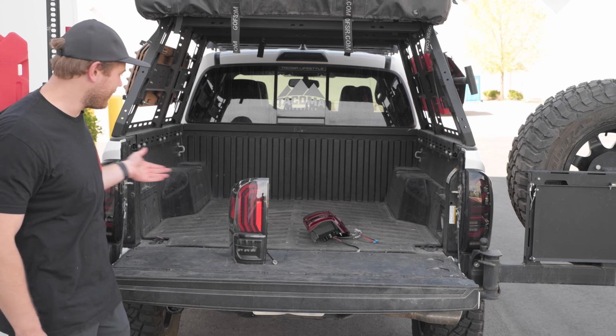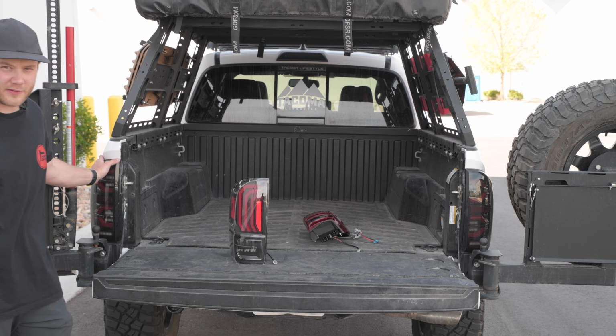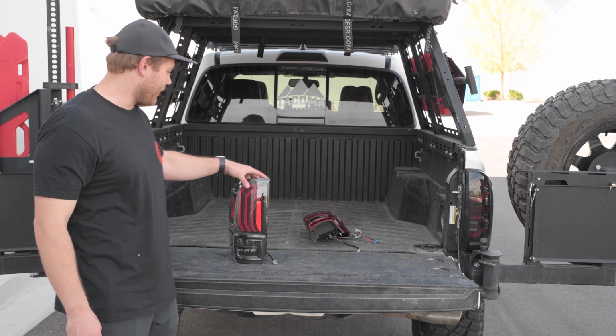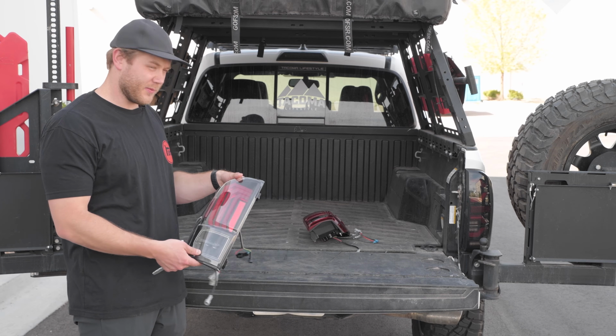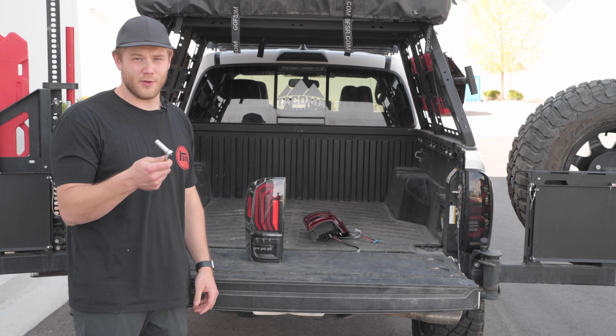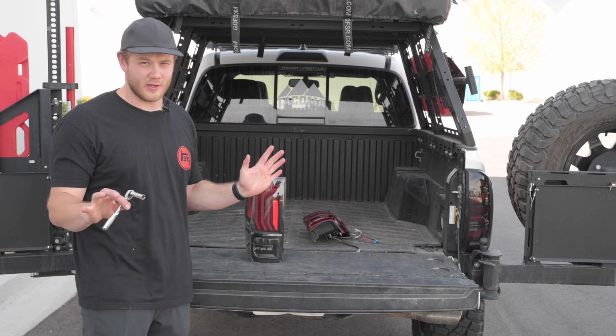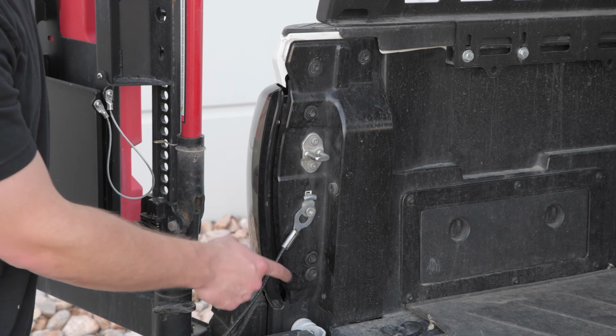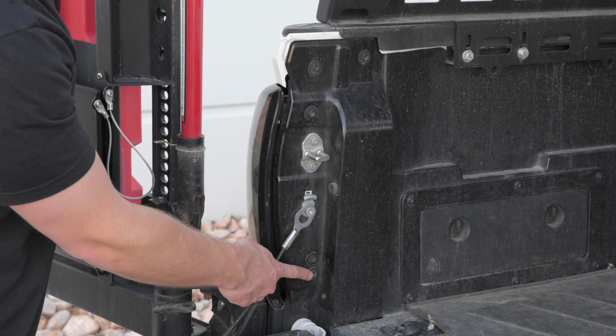As you know, before we did a video putting on my Alpha Rex Lux Series taillights, which I have loved. So we're gonna swap those out and throw on the Meso. It is a super easy install. You just need a 10mm socket wrench, and that is all you will need. To start, all you're gonna do is remove this top screw right here and this very bottom screw right here.